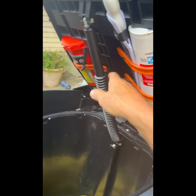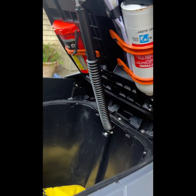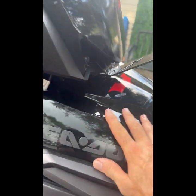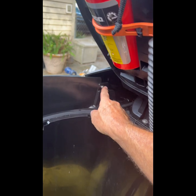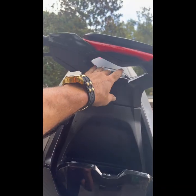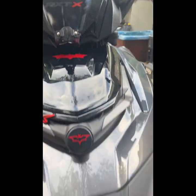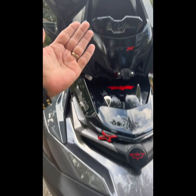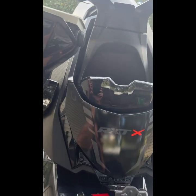Before you can take off the shock absorber, after you take off your ErgoPanels, you need to take this front cover off. To do that, you have 2 bolts on the inside — a small bolt, I think that is 10mm on each side. When you take these 2 bolts off, this slides forward. After you take off the shock absorber, you can put a bungee cord up here, and then mount it if you have the eye available on your trailer. It keeps that cargo hatch all the way open, and it makes it easy to then get your cargo plastic up and get to your fuel line.